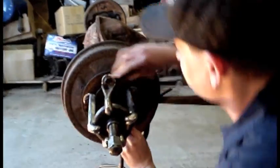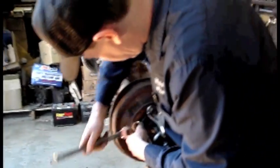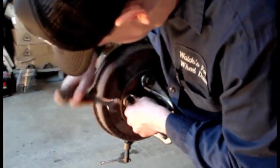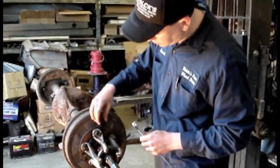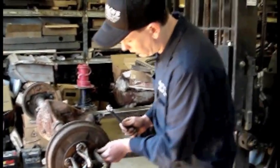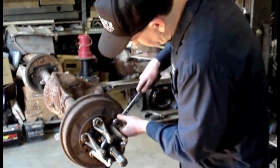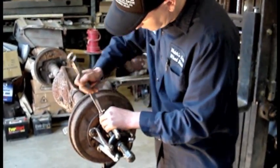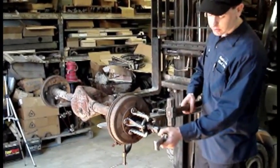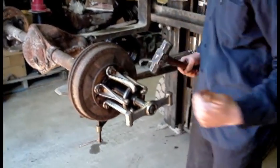Once you have all the nuts on there and tight, just go over it once with your wrench. They're a little hard to get into. You don't want one side real loose and one side real tight because it'll pull it off awkward and it usually gets stuck. Then put this handle on here — you'll actually hit this with your sledgehammer and it'll drive this in there and pull it out.